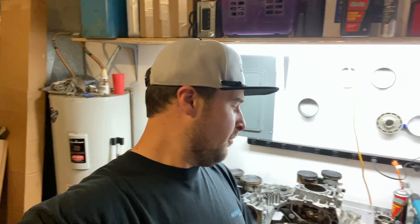What's up guys? I got a little video coming to you today here in my garage, Steve Toon Garage, where all the horsepower gets built. So I've got a stock short block on the bench that I've torn down. This is a short block that was brought to me because it burned a lot of oil. It was rebuilt by somebody else, doesn't have very many miles on it, and it's burning a ton of oil. We're going to talk about ring land failure today.